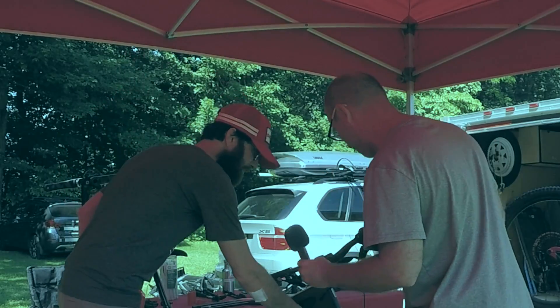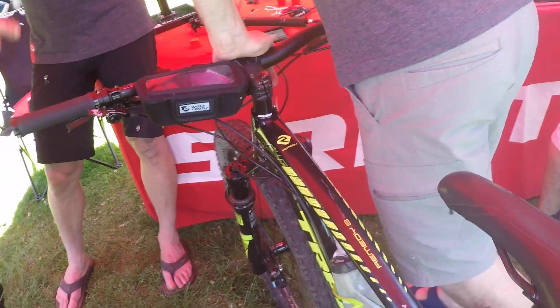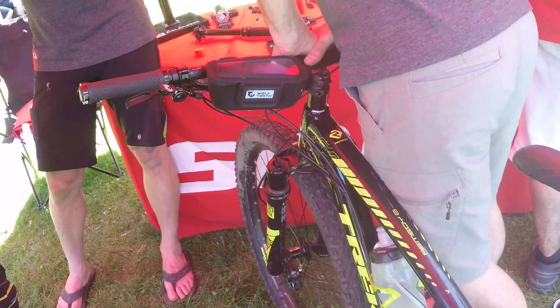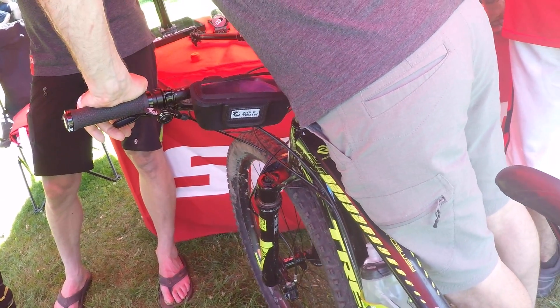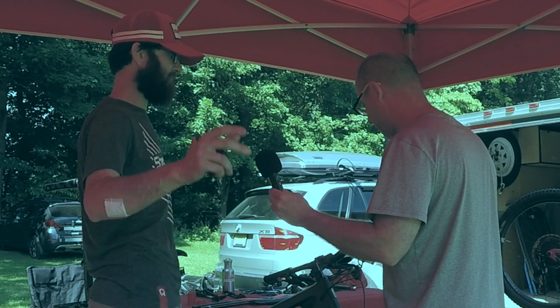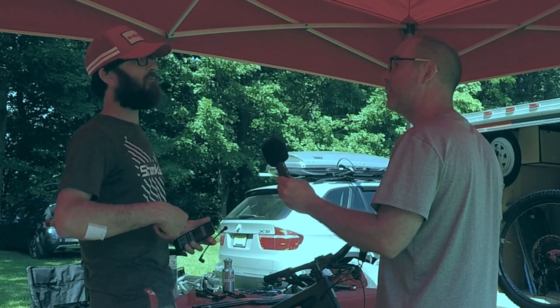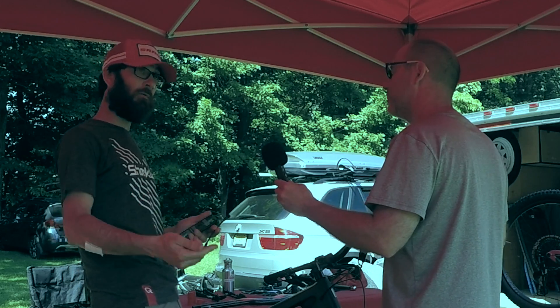It's a simple thing. You zip tie it to your bike, you have a little air hose that you fit to your air fitting on the fork. You do a baseline compression test — basically you remove all the air and hold the fork down. This guides you through it, it's super simple, goes step by step. It takes two minutes to do an air setting, and then you just go and ride. It tells you if you need to ride more to acquire more data, or exactly what to ride — big hits, jumps, flat terrain. It gives you all this live feedback.